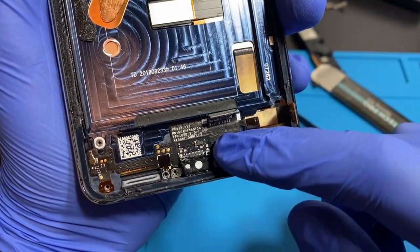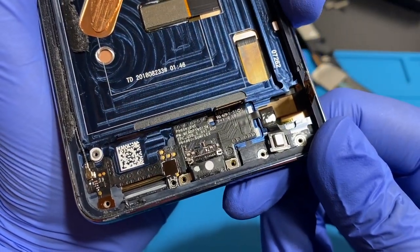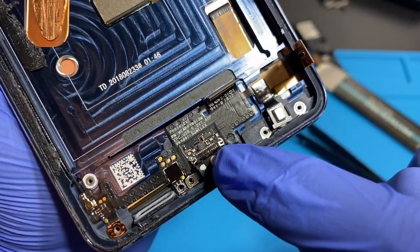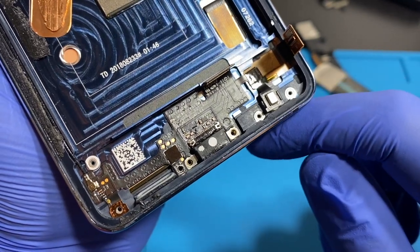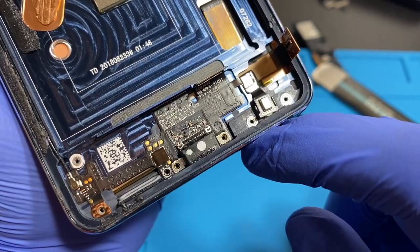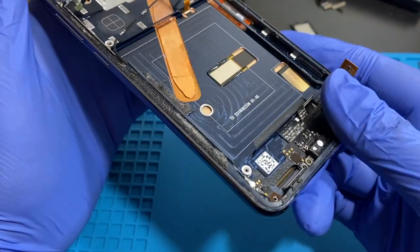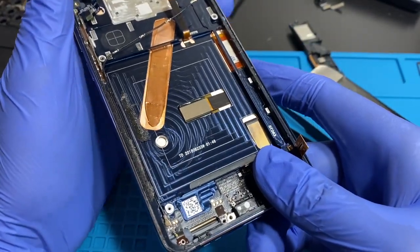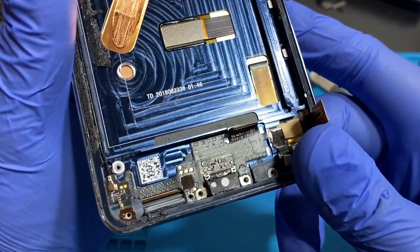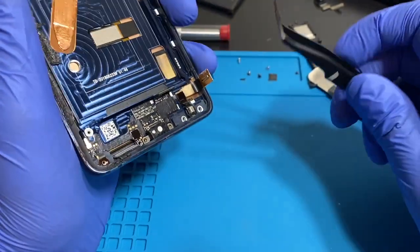Wireless charging is probably the only option. It's just sad that Nokia has resorted to this. I could heat this thing to 200 degrees and reflow the existing solder, but the display is still underneath there — that's the other annoying problem. And even if I figure out a way to solder it while it's in there, what's stopping it from breaking again? This thing has a lot of give to it. Before anything starts moving, these two pins aren't really doing their job. I don't really see the point of fixing this — it's just going to break again.